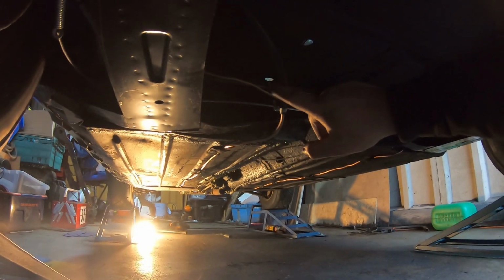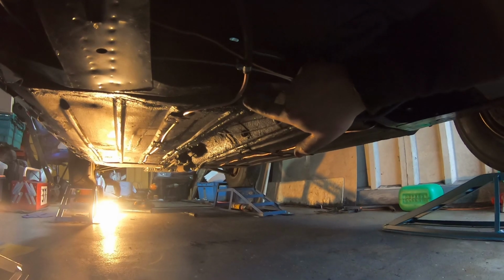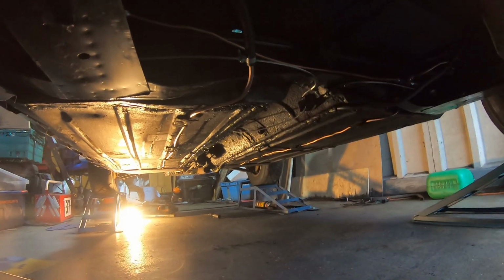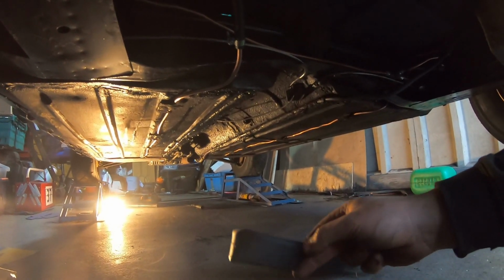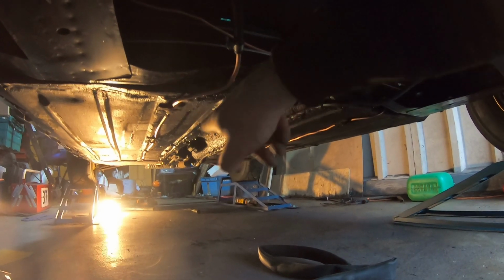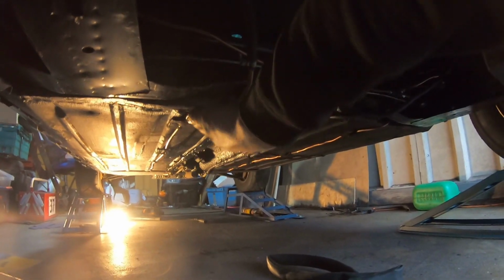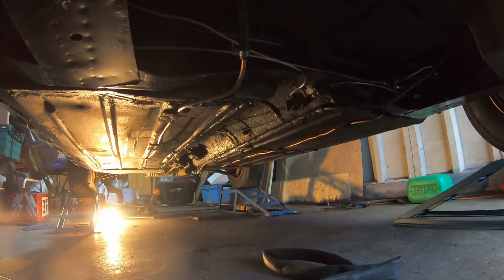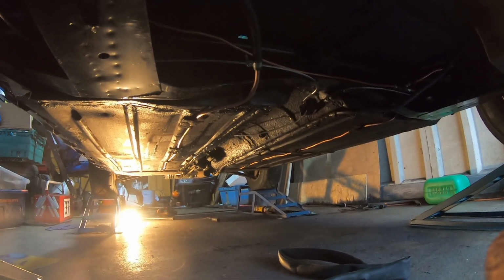Right, so you can see that the flexi hose is here, or the fuel hose. Then I've bent it around to here so I can put a clip from the bracket on the subframe to the brake pipe, and then it's clamped into these little tabs. Now on the brake pipes I had some rubber, like plasticky rubber spirals that go in. I haven't got that for this, so what I'm going to use is an old bike inner tube. I'm going to chop off a length, and then I'm going to wrap it round, it's like a half moon, put it back in, and then I can clamp the pipe up. Now doing that, it's going to stop any rattle, so you don't want to drive down the road hearing that. It'll also give it a bit of extra protection as well from wear and tear and stuff. So once I've done that, I can put the fuel in the car and then turn the key. It should fire into life.